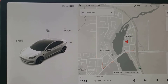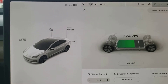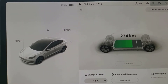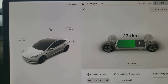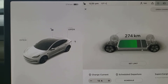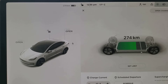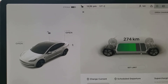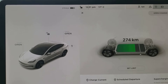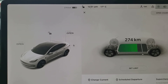Instead of guessing, let's just take a look at it. I had this charged this morning up to my limit, which is about 350 or so. For those of you not familiar, Tesla suggests — and most battery people suggest — that you do not charge your battery beyond about 80% consistently, because you end up with effectively stalactites in your battery that can puncture the cells and cause a fire. Don't worry though — this is on thousands and thousands of recharges. It's nothing to be particularly worried about, but good battery hygiene says don't charge it all the way. Anyway, I've driven mine about 75 km today, so let's charge it up.